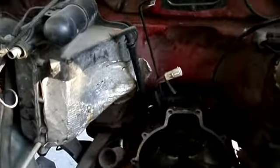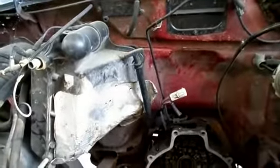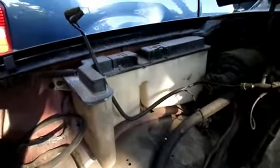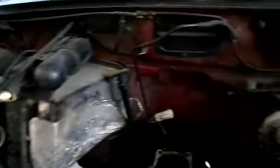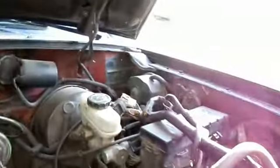If you think about it, it's been probably almost a year since I've opened this hood. Been working on other stuff. So, we're getting back at it. I want to paint this engine bay. The truck's black, but it looks like it used to be red. Inside here it's all red. But I'm looking at it and it looks like a big project to work on, because I have to take everything off and then clean all the grease and dirt off and then sand it a little bit to get it rough and then primer it, then paint it. And I want it to look good in here, but I don't want to spend that much time making it look good in here.